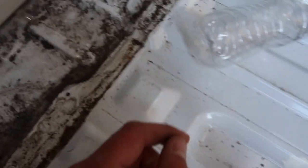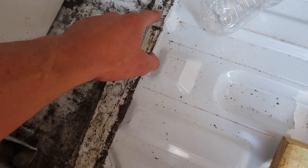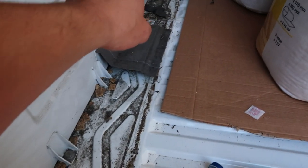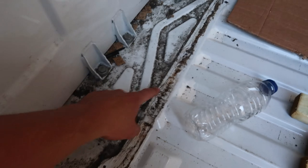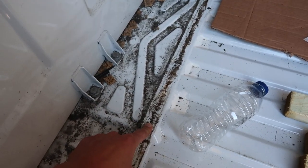The main bit of the bulkhead is out. Just a note: when you take all the bolts out the front and pull the bulkhead forward, there's actually another sequence of star head bits along the back here. So you just fold the bulkhead forward, sneak in behind, and obviously take them out. Two people would be handy, but you can get it done with one.